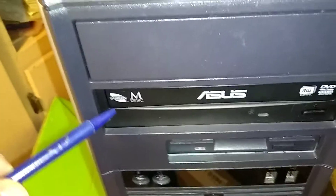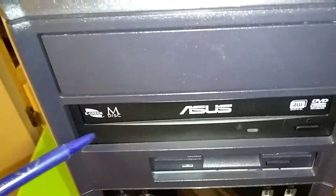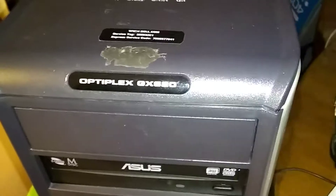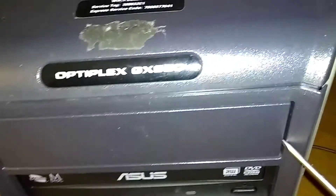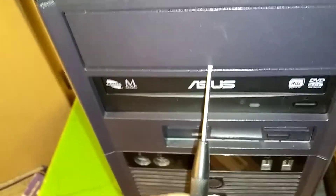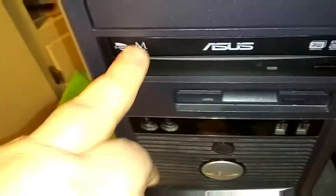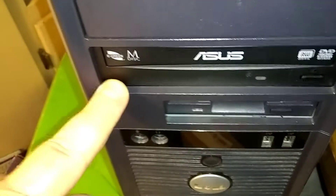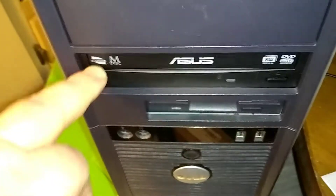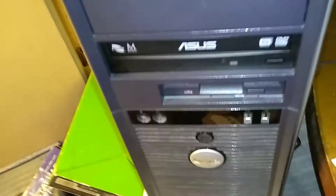Here's my DVD-ROM. You're going to take your front panel off — there are two panels on here. If you don't have anything there, you'll hit it with a screwdriver on the edge or come underneath and pop it out. That thin panel will pop right out — that's where you put your DVD, CD-ROM, or CD player.